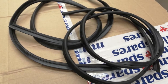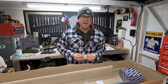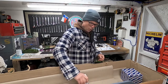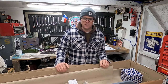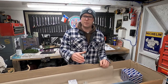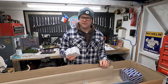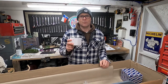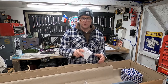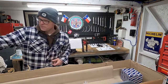Seals for the standard Cooper S 7.5 discs on the front. Yes, I'm actually running standard discs on the front of the Mini — because that's all I've got and all I can afford. I'm going to run the standard discs and standard calipers, but I'll upgrade the pads. I'll have some fairly decent ones for on the road so I can test the car, and proper competition pads for when I'm competing. In the future, if I can afford it, I will upgrade the discs and calipers at least — but I just want to get out there first.